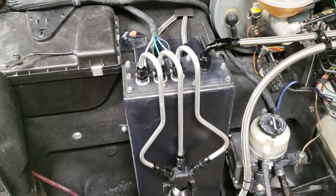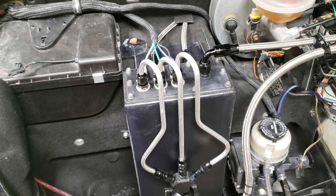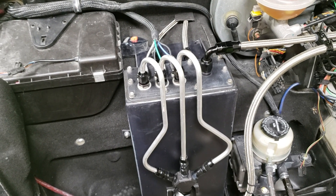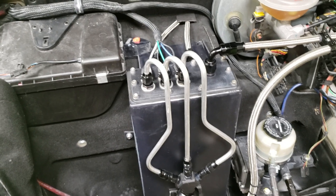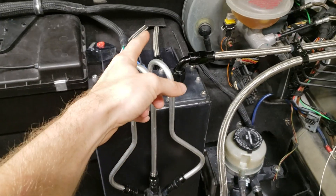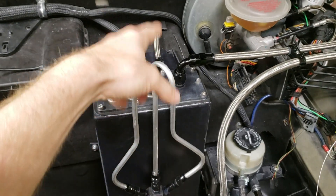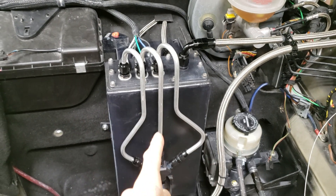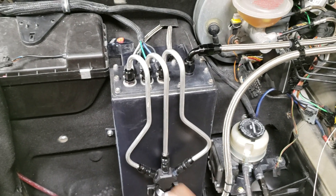I realized this when I went to wire up and plumb the EVAP system — there was no EVAP system. Clearly that can't happen. So I'm trying to find the EVAP line, and I realized that the EVAP line was the return line. Because of that, the main fuel pump — there's a regulator in the tank set for the motor — so this thing filled up. It was like 70 PSI, 100 PSI, because it had no return at all.